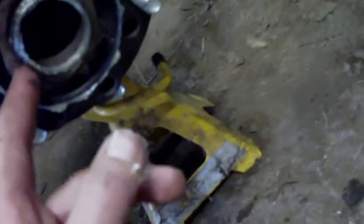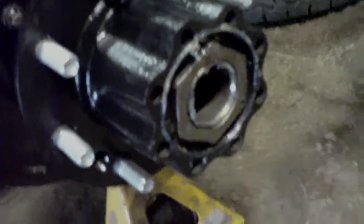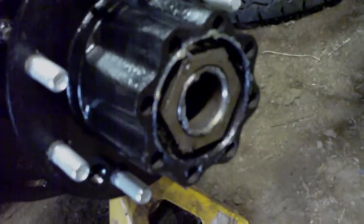Basically, with your fingers you can't tighten it anymore. At that point, I'm just looking for the keyway — there's the keyway on the front of the axle right there. You take your lock washer and install it. You're supposed to back the adjustment nut off until it matches one of the tangs and then bend the tang over. Once you've set up your lock washer and inner adjuster correctly, you thread on your lock nut. They're a little vague on that one — they just say tighten it until it's secure, with no absolute torque value.